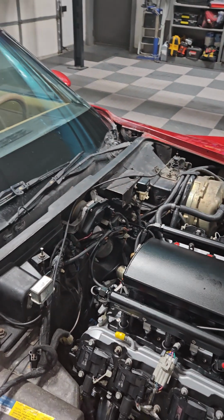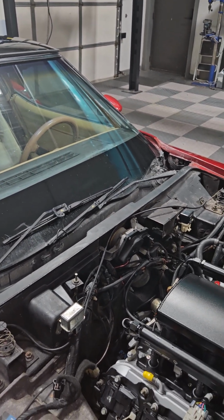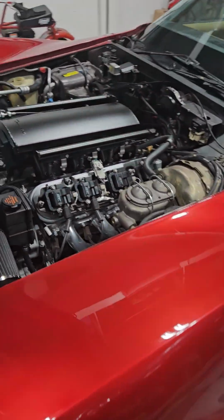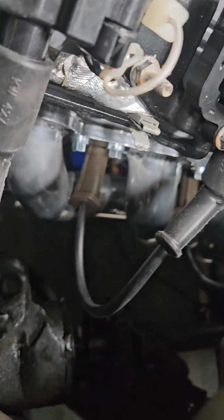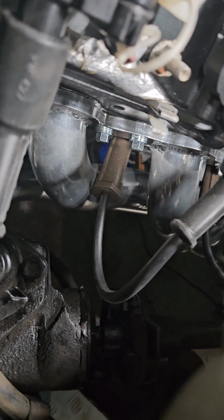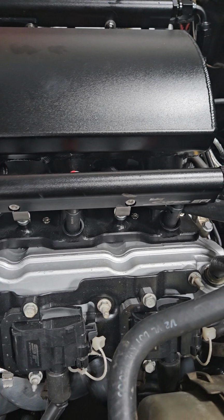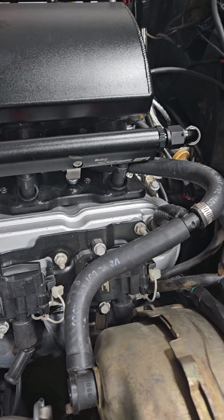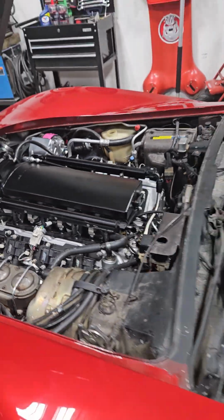Your gas gauge, of course, that's nothing. I put a new fuel injection fuel tank in it back there and just tied back into the factory wiring, so that was pretty easy. The oil temp on these cars from the factory was an adapter fitting down above the oil filter. You won't be able to see much down here at all, but there's a brass piece, a fitting right by the oil filter. I took the factory sending unit out of the small block and screwed it into the quarter NPT fitting on this oil pan. Plugged the factory wiring in. I had to extend the wiring 6 inches to make that one work. So it was pretty straightforward.